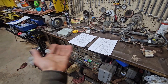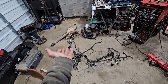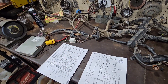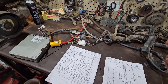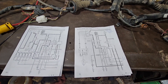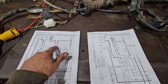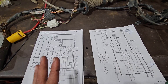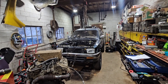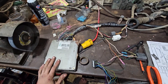This system is going to be basically standalone anyway because it's so separate from the chassis harness. There's nothing that actually connects it to the chassis harness other than the body plugs, which we're going to be merging with our T100 harness to make it plug-and-play. But I want to integrate it into the factory Toyota fuse box and make it work like it's OEM, hooking it all up through the main relays that already exist because they're actually tied in very similarly for both vehicles.